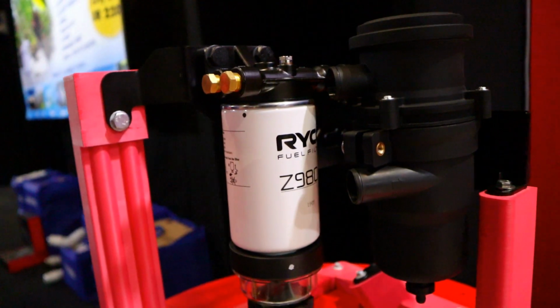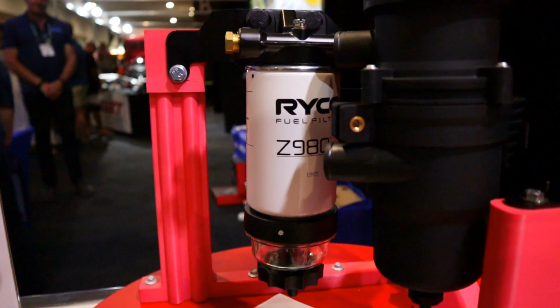For those who don't know what an oil catch can does, what is it actually doing? Okay, the main reason for a catch can is with late model diesels, the inlet manifolds start to block up over time, and the reason they block up is because you're getting oil vapour out of the rocker cover, coming into your inlet manifold. That oil is supposed to be burnt, but it actually sticks to the side of the intake manifold. Your EGR valve then opens up and all your diesel particulate goes in, sticks to that greasy surface, and all of a sudden you get a peanut butter paste start to build up. So if you can avoid that, your inlet manifold doesn't have to come off, and it's about a $1,500 repair if it does have to come off. So you're removing all the oil vapour from going into the engine, and that gets stuck in the catch can.